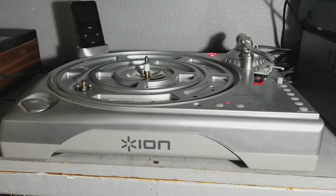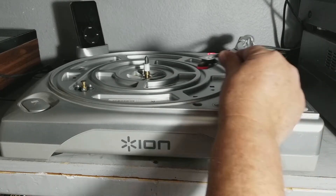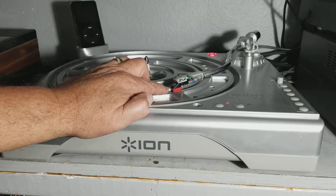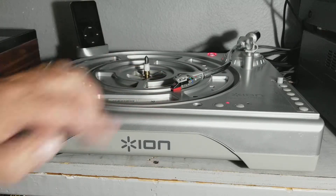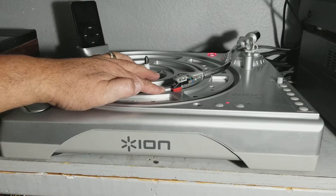That works in most cases, unless you've got a really bent platter. The next thing is the tracking force on the stylus — it's never good. What I notice is if we set it right down here, you're not hurting the sensitive needle; it just fits in between the groove. There's no manual or documentation to tell you to set it that way, but I just found that if you put the stylus right there — because if you try to adjust the stylus on the resting arm, it's not going to work, your balance is going to be off. The only way you can get a true balance reading is to bring it over here to the center.